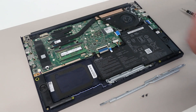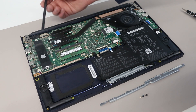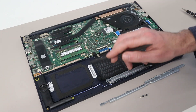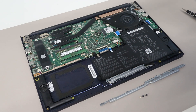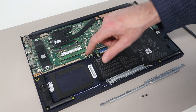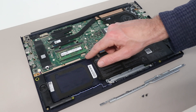With the bracket removed, we can also see a connector here for a SATA hard drive. This laptop, as standard, came with an SSD — a M.2 drive — not a hard drive. The cable and rubber bracket for a SATA drive are not included with the laptop, unlike some manufacturers; however, they are available. I will list a link for the items along with the part numbers in the description below, along with other tools and parts featured in this video. If you want to add this second hard drive, it would be a simple case of inserting a drive into the rubber bracket, attaching the cable, and installing it into there.